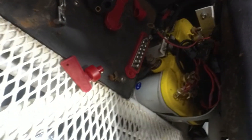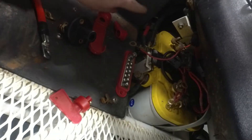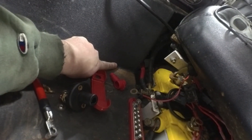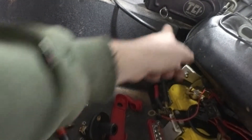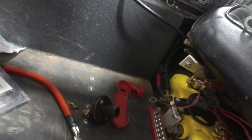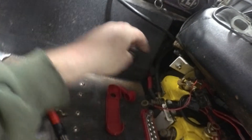What we're going to do is make a little aluminum box that goes from about right here to right here and comes out about this far. We have to be careful not to hit the bottom of our leg. We want about six inches across, a two-inch rise, and a three-quarter inch foot on each side to bolt it. We'll put a back piece on it and mount the key switch on the bottom. We're making it six inches tall so we can add a couple more toggle switches if we want.